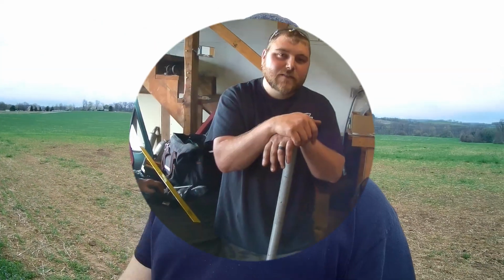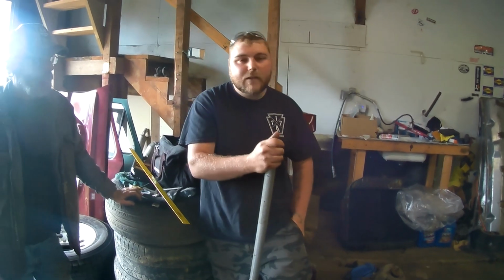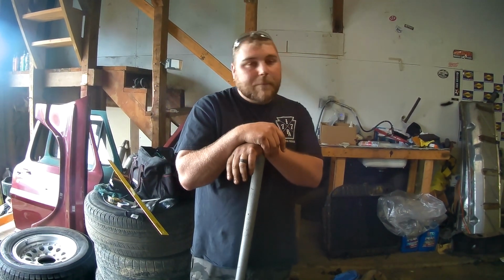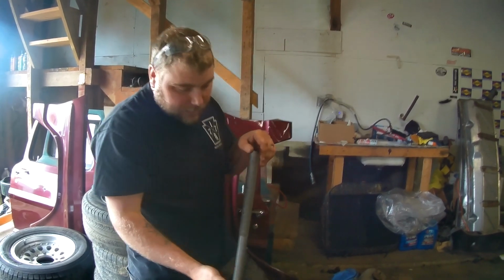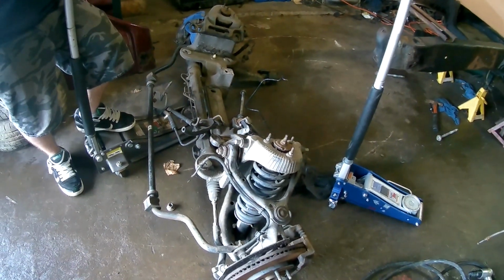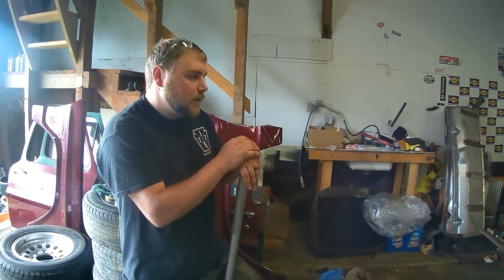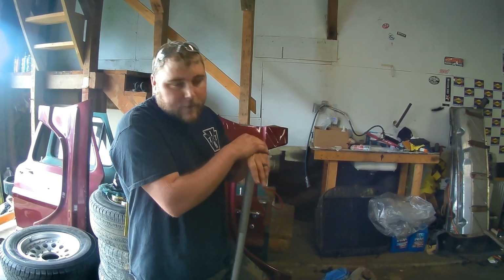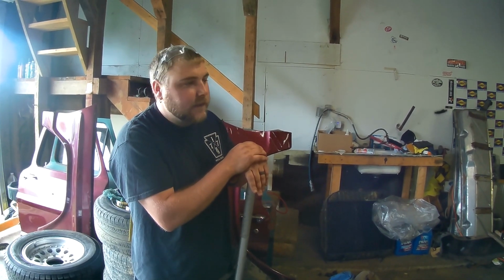Alright, so the truck Chad's working on started life as a 1972 F250, long bed, 8 lug, flatbed. We chopped 15 inches out of the frame, made it into a short bed, converting it into a Crown Vic swap, 5 lug, with the 8.8. So now it's still going to be tagged as F250, but appearing as F100. 5 lug, short bed. They never made a F250 in that way.